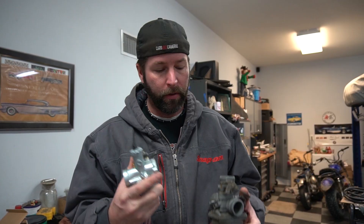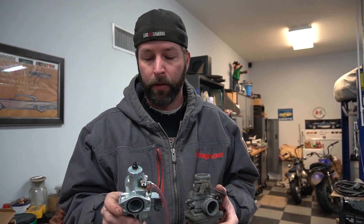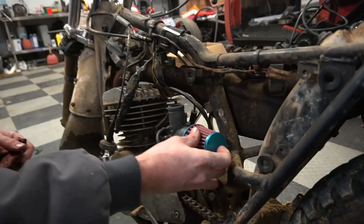So we've been looking at our options for carburetors. The one that John ordered was too big. Then John suggested a Mikuni, which I thought was a great idea. We usually use these on our 212s from gopowersports.com — it's considered an upgrade for a 212, and this is a 250. But the Mikuni bolts on whereas this one slips on, and the throat of the carburetor is a lot smaller on the new one. We could run it lean enough with this carburetor that we damage the engine. So I guess we'll keep searching for another carburetor. The good news is that the Mikuni air filter is going to fit right on our Mikuni carburetor.